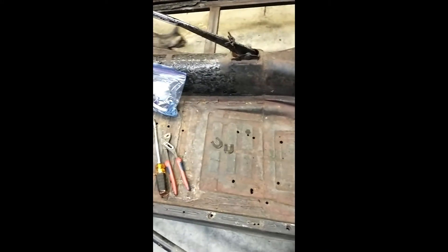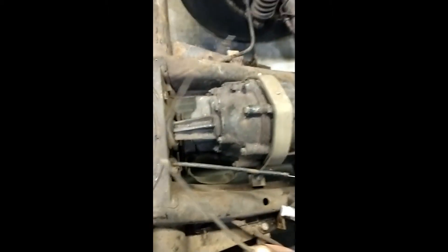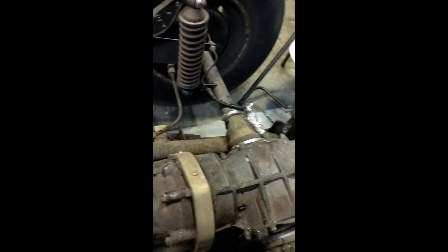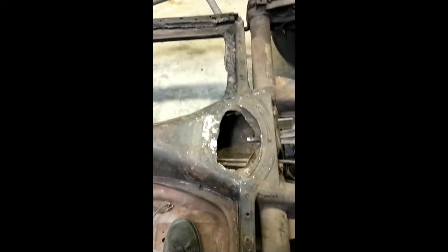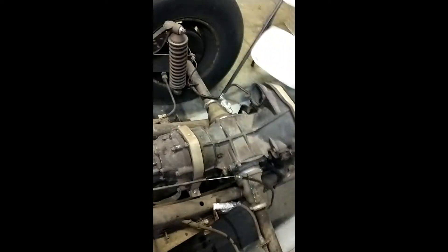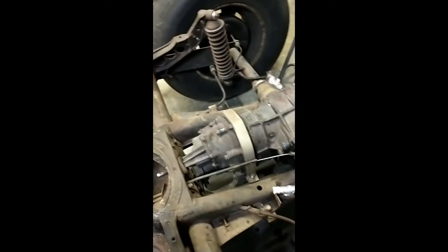Here again — used these essential tools to release the rear spring clips on the rear flex brake lines, which are now wrapped up in plastic. Disconnected the three-way splitter and the two rear hard brake lines, and except for the two cables leading to the emergency brake, that's all that's connected up to the rear end now. We just have the suspension torsion bars and the brackets holding the transmission in place.